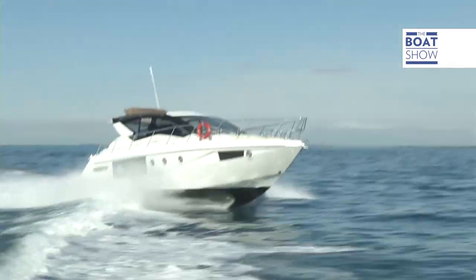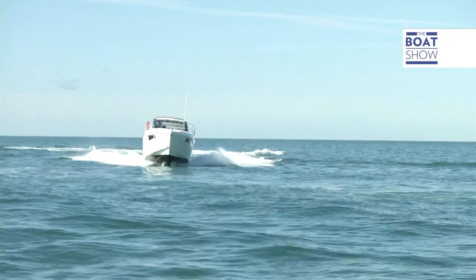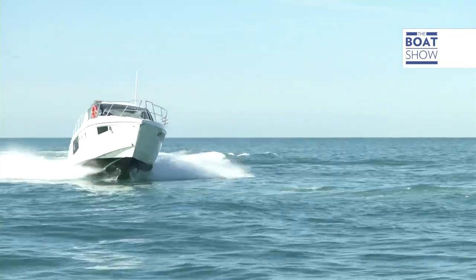We're at 2,500 revs a minute and consuming about three and a half liters a mile. You can really feel the waves. I'm slightly at fault here — the waves should be tackled head on. If we put one of the boat's sides up against the wave, the water's going to hit hard against it, and it wouldn't be long before you'd need lengthways runners — skates — in order to cut it. So it's better if we go against the waves like this.